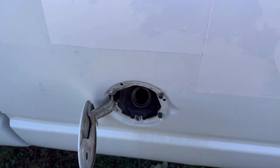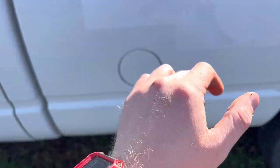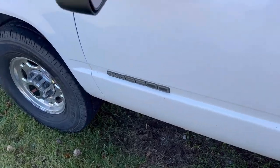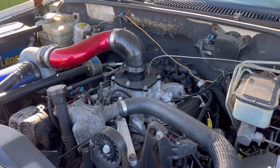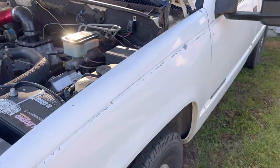The other thing you can do is take the fuel cap off, put a rag in there, add about 15 pounds of pressure to it, and take the line off the front of the lift pump. When you pressurize it with air, it's going to push up through that sending unit and out the line at the back of the lift pump. You'll end up with either a consistent stream or nothing. If you get nothing or a very inconsistent stream of fuel, there's a pretty good chance your tank sock is clogged.